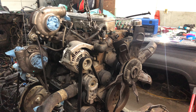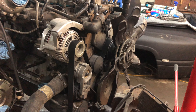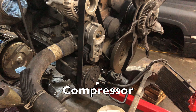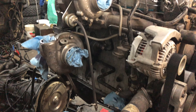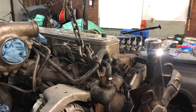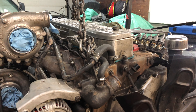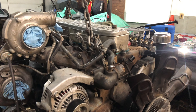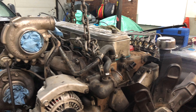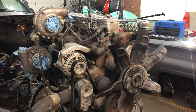I've tried to remove this entire engine as a complete unit just to really show every single step that goes into dismantling it down to a bare block. Normally I would have pulled off the fan, the alternator, probably the AC condenser, and left that with the truck. I would have pulled the turbos and the manifold, and then last time I actually pulled the head off and used a load leveler into the block itself, and that way I didn't have to pull the pan off.